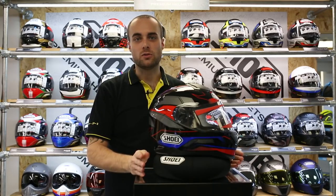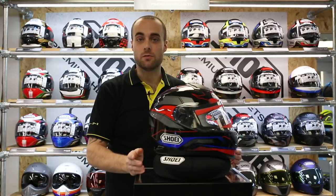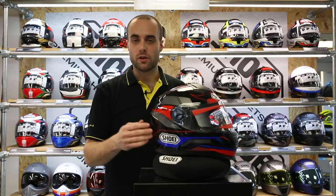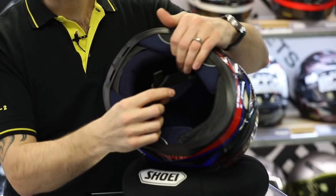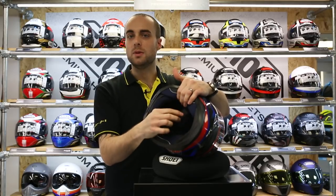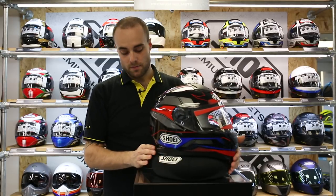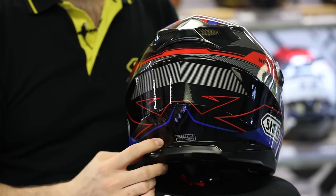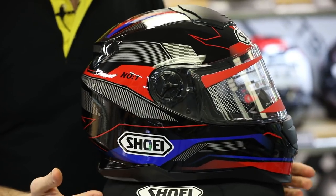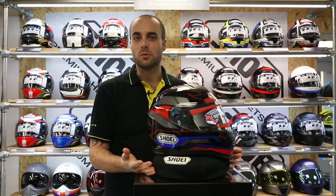When you're buying a new motorcycle helmet, you're looking for the ECE mark, which means that the helmet has been tested and certified in a particular country for the market it's been distributed to. Normally what you'd find on the chin strap is a small label with the E mark and then the number — so if it was tested in the UK, it would be E11. On this particular fake, we cannot find any E marking at all. The only E marking we can find is the sticker on the back, which doesn't certify that it's an ECE certified helmet. In our opinion, it is not safe — it's not been tested, so we don't really know the actual performance of the helmet.